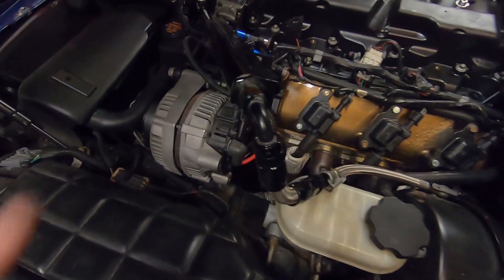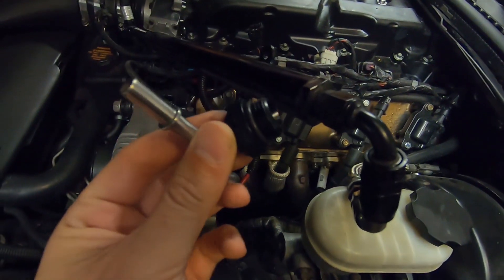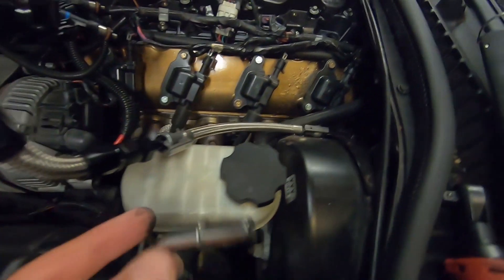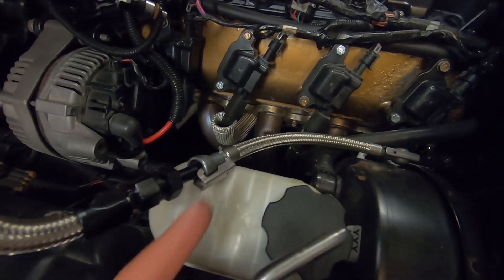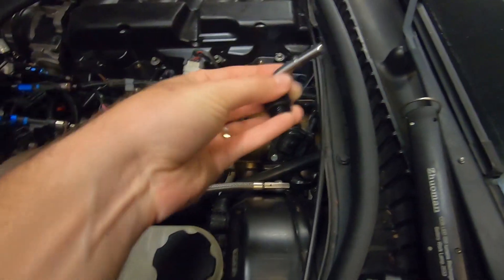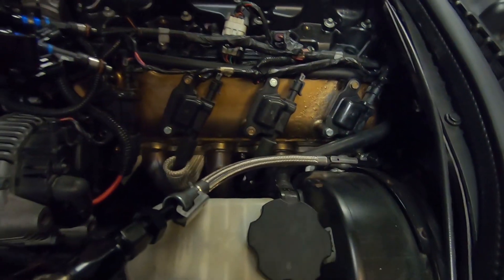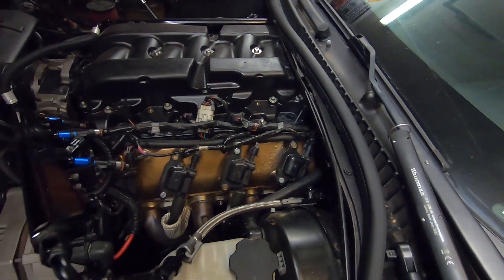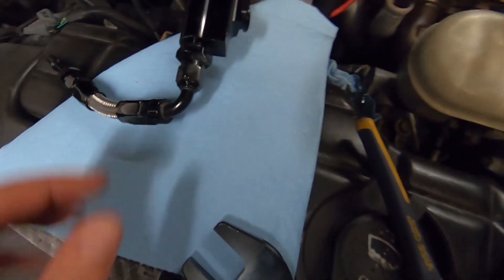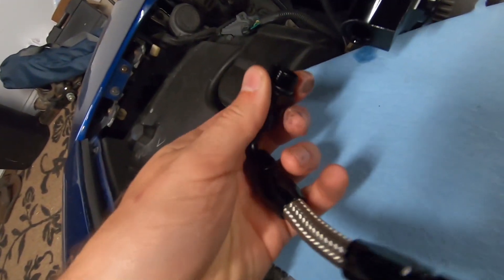It's gonna make two connections when we're done, which I feel a whole lot better about. So I'm gonna loosen this up and slap it on. This is gonna thread into the fuel rail right here and then this elbow is gonna come down and push right into this. There's enough room for this length to go right back in there, and that line has some flex so it'll push back and just pop right in the back. Here's the Earl's Plumbing piece — got it loose, had it on there super tight, dribbled a little fuel.